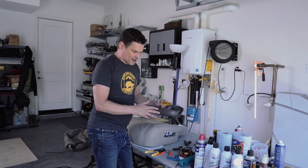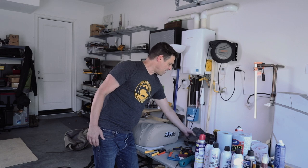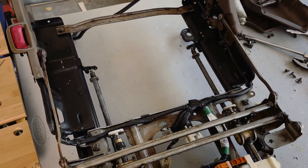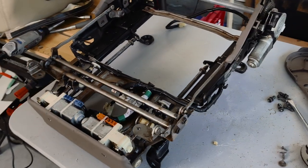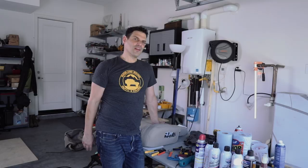All the little components that go back on the seat — just take them to the kitchen sink and wash them with soap and water like dishes, incredibly easy. You can't put your seat back together until you wash your seat frame and get it nice and clean. I recommend brake cleaner — it cleans, washes, and evaporates right away so you can blast it clean quickly, but you'll need probably three cans per seat. You can also use engine degreaser or soap and water — it'll just take longer. If you have a 25-year-old rig with an electric seat, make sure you re-grease the worm drives so the seat moves fluidly. Electric motors do go bad, so unless you change them you may not get factory-new performance, but you can change the motors if you want.